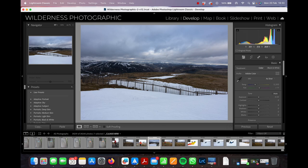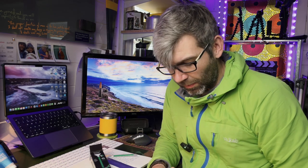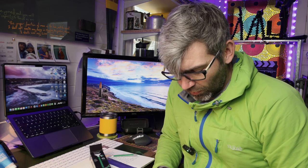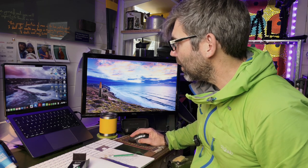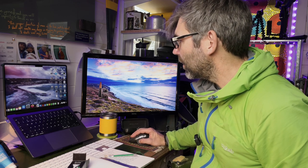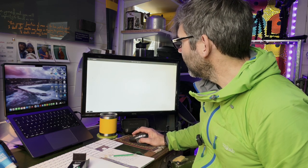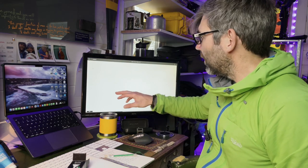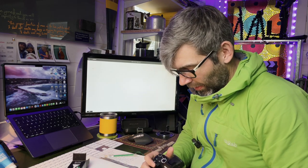But I don't want to have to be doing that with every image that I take, so I do want to clean the sensor properly — which is what we're going to do now. In order to find out where my dust spots may be, I've got a 20mm lens on here, but if you had a zoom lens you might go to quite wide — you want all the sensor kind of included. You can use a whiteboard or a white desktop; I'm actually going to use a computer screen. I've just got a white screen up here, and I do have blemishes on the screen itself, so I've got a little trick to get around that too.